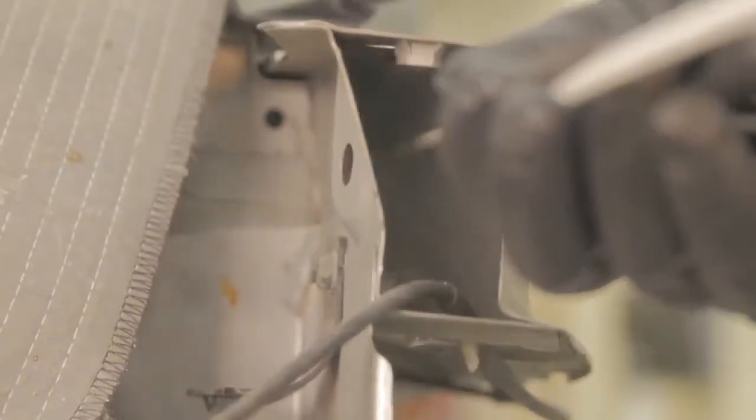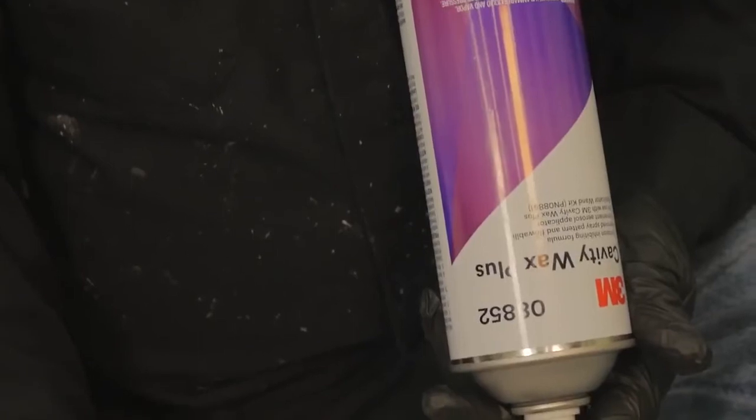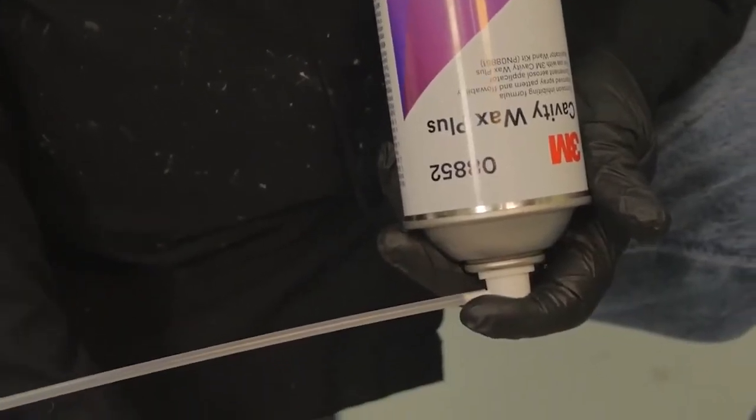Here's a question: you're replacing a brand new hood on a Camry — what corrosion protection items would you put on that brand new hood? You would put on a factory seam sealer tape, because that comes with no seam sealer. You would put in cavity wax — cavity wax would be put on after it's painted. Make sure we don't put it on beforehand, because it's like trying to paint over grease or oil. It ain't gonna stick.